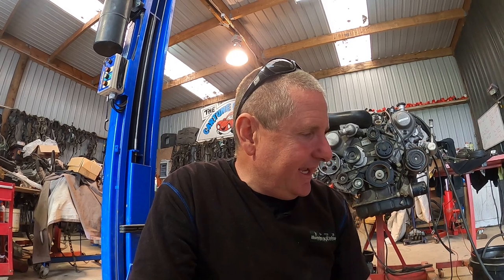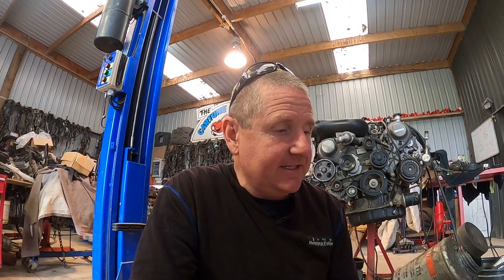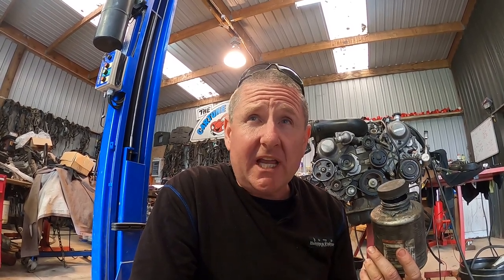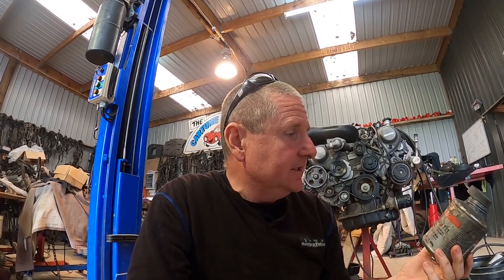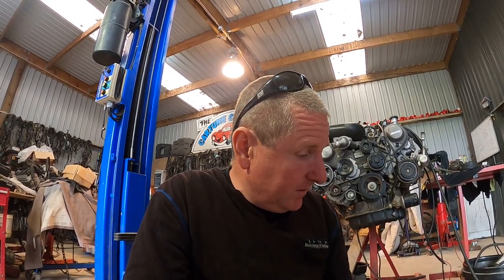For this standard car, a standard spark plug is going to work. Do not use copper anti-seize in an aluminium cylinder head — that's bad. These spark plug holes are a bit yucky. They should screw down all the way by hand. So I've put some workshop glitter — nickel anti-seize, Loctite nickel anti-seize 771. Now let's slam some spark plugs back in the hole.